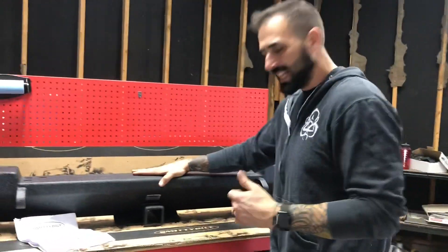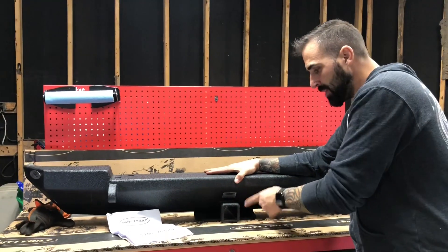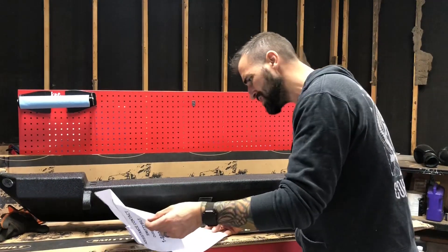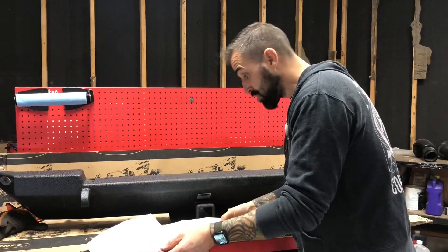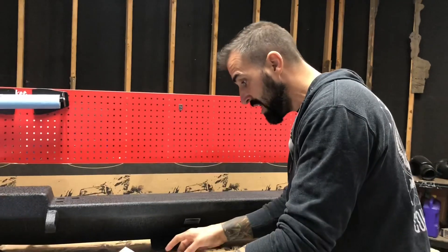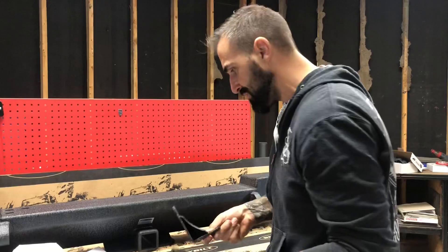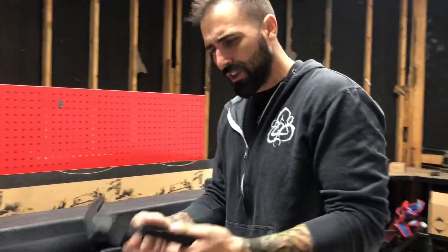What I didn't realize is that most bumpers — the trailer hitch is good for a recovery point but not for towing. But this one here is a class four. The instructions say it does like 9,000 or 9,500 pound tow, which is great because I just threw my tow setup into the attic. That also gives us a couple extra mounting brackets that have to go into the chassis. And if you have a YJ, they give you the brackets for that as well.